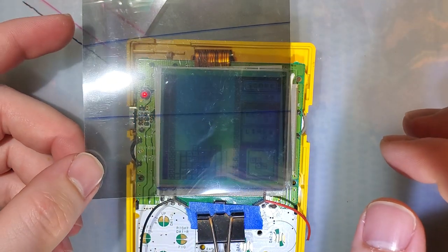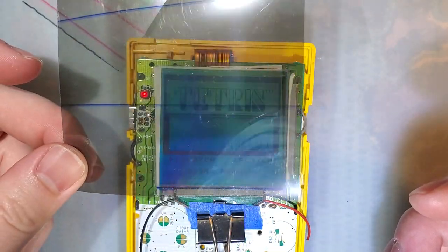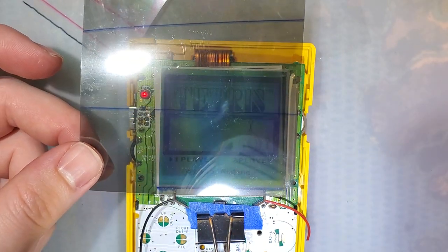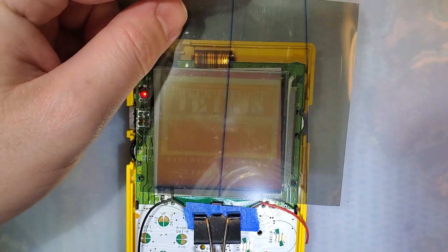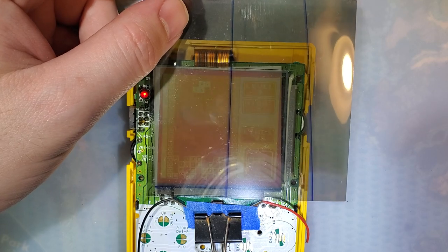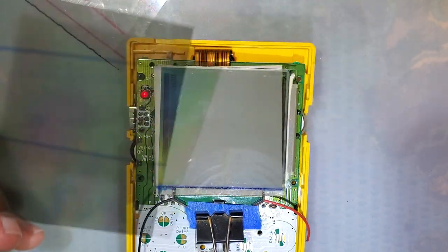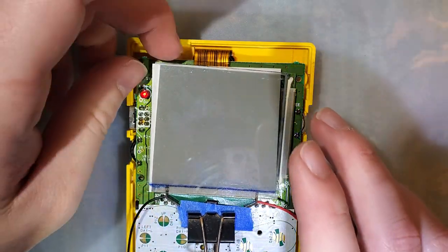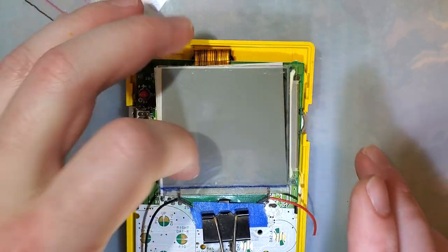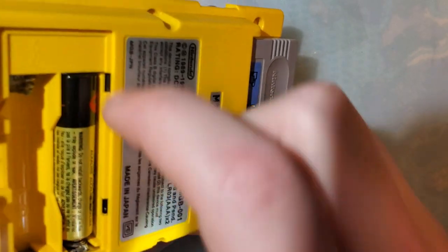So I'm going to leave this one as is, and quite frankly, if I had a bivert module, I'd show you the process. But if you are biverting, the only thing you'd need to do differently is twist one of the polarizers. It doesn't matter if it's the front one or the back one, just need to do one of them. I didn't bother mentioning that on the back install because I figured I still had to do the front one. And quite frankly, it's just easier to twist the front one than it is the back one.